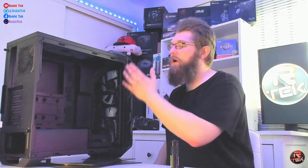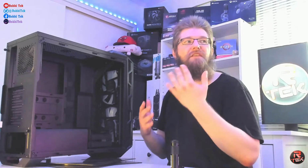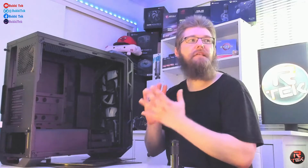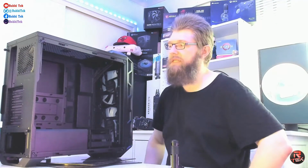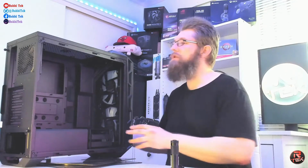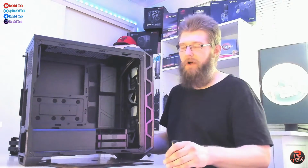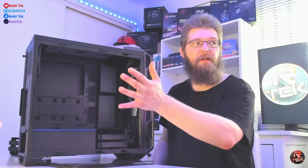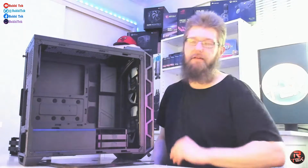But the nature of the 200mm fans is there's always continuous intake going, even though you don't actually physically feel it coming in. There is a current that's occurring, and that's all you sometimes need, and that's why they're liked as opposed to 120s or 140s, because the sound isn't as deafening to get the same amount of air movement. It's almost like an illusion which you have to acknowledge, otherwise it doesn't make sense. If you have a big fan, everything's moving in the room, but you're not actually feeling the fan. Do you get me?